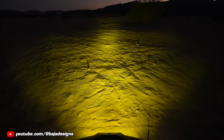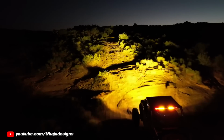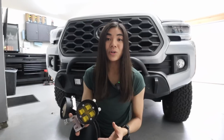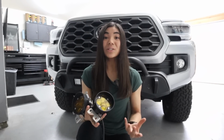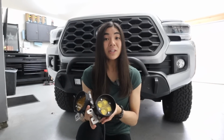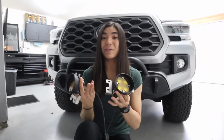Baja Designs actually has a really great video about this exact topic on their own channel. But to summarize, the amber is going to be better for inclement weather situations and terrain recognition in general, because the selective yellow color, which is lower on the Kelvin scale than your blues or violets, is less optical workload on your eyes. That's not to say that clear is worse, because in other situations, like maybe open desert fast driving, clear might be a better option. But anyways, I just wanted to give you guys that information in case you were curious. The new gens come in both amber or clear color. I might switch them down the road, but we'll see.